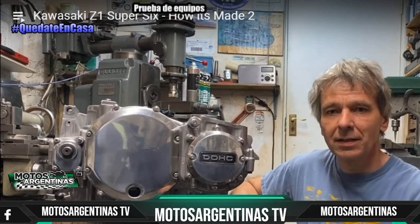In this video I thought I'd talk about a couple of easier items to make for my Kawasaki Z900 Super Six. So I'm going to make the sprocket cover, where I have to modify it to make it wider, and I'm going to make the starter motor extension cover from stainless steel. I'll show you some of the techniques and methods I use.